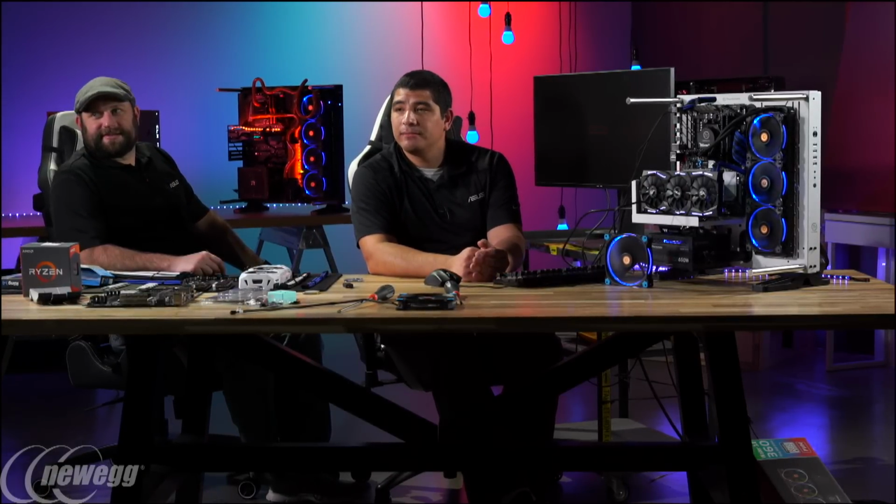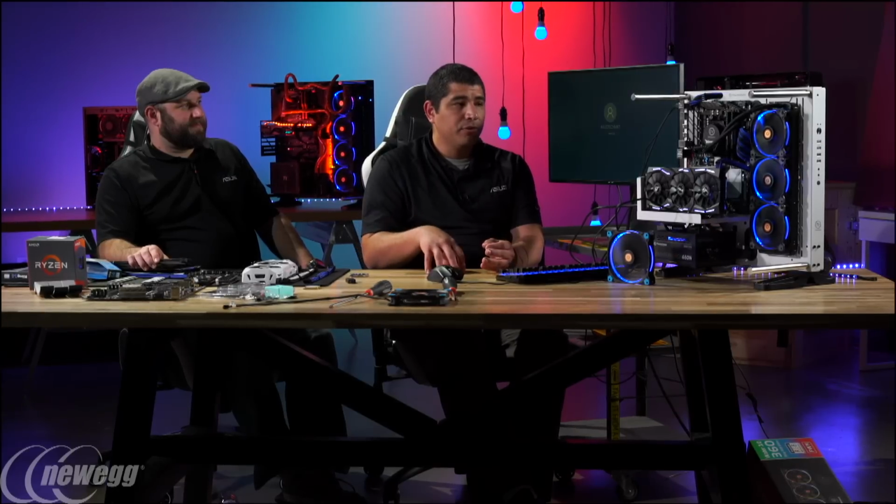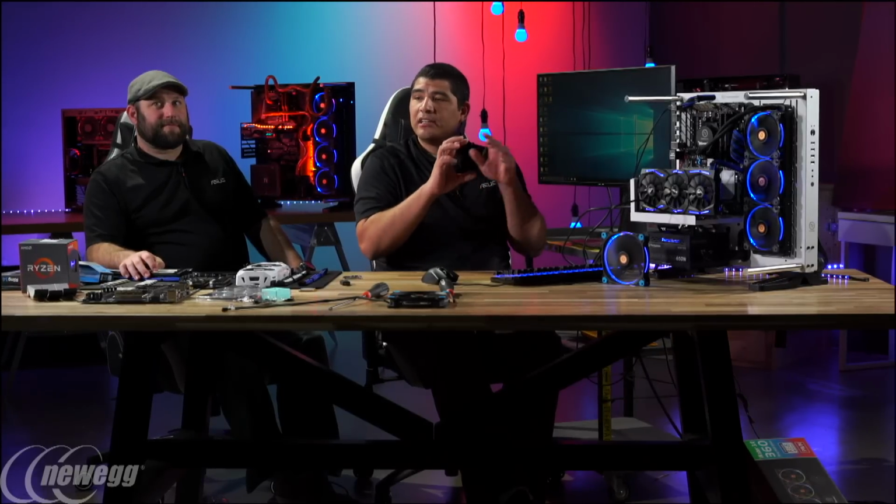Hey JJ, got a question from our Facebook crew, which is pretty sizable right now. True Volt, is that going to be supported on the new AM4 boards? Right now all the key technologies, in terms of pure power, XFR, all those things, we've worked with AMD to enable all those key functionalities as far as the architecture implementations. But there is still a lot of design work that AMD is helping to enable through firmware updates for the CPU. So over the next month or so, we're going to continue to see more enhancements for granularity and control for DRAM and for CPU control. This is where I think the long-term UEFI support matters. Not a lot of people realize this, but one of the big differences between boards on the marketplace is long-term firmware support.